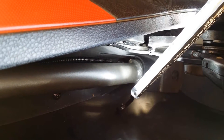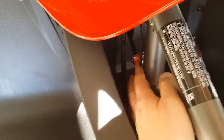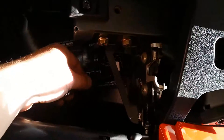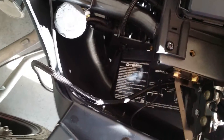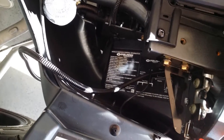To run the wire from the back to the front it took me about a minute. You just run it here. On the SL model, the speaker wire for the enclosure comes down the front here — I'm just going to zip tie this all up when I'm done to make it look clean and factory. It pokes through right here as a convenient little hole. I'm actually going to mount the fuse block right here next to the factory fuse block. It's a good location because it's away from engine heat and won't get hit by water.